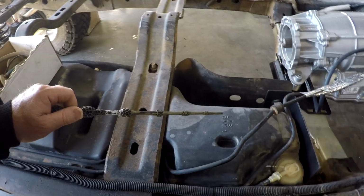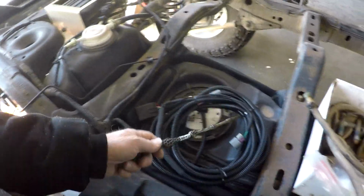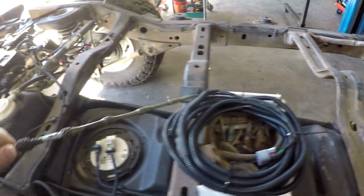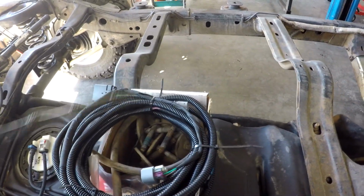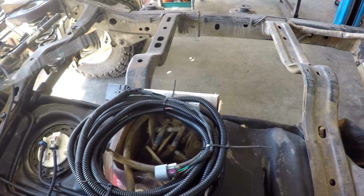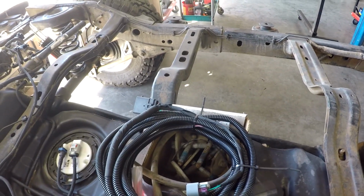You can tell if you've got a 4-door or a 2-door tank by looking at this here. This is long wheelbase. If this wasn't a 4-door, it wouldn't say LWB. Now this is our chassis harness, and we have this connector that goes up against the GM chassis connector. We've got one O2 sensor, we have our fuel tank pressure sensor, and our evap vent solenoid. And this is how GM does it. They actually separate the chassis from the body. So we mimic exactly what GM does.